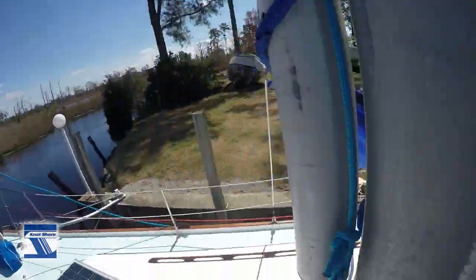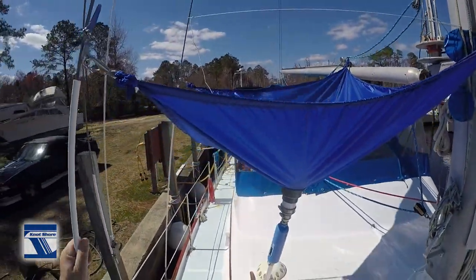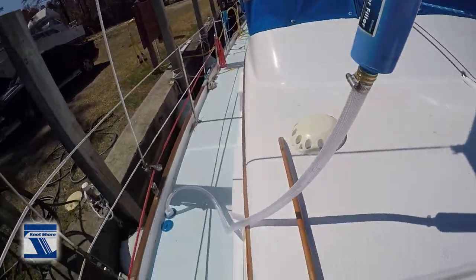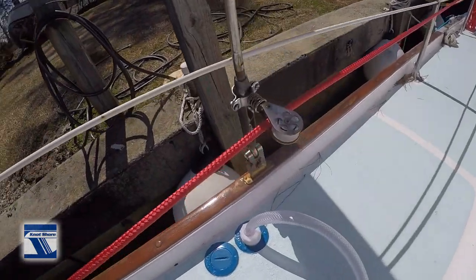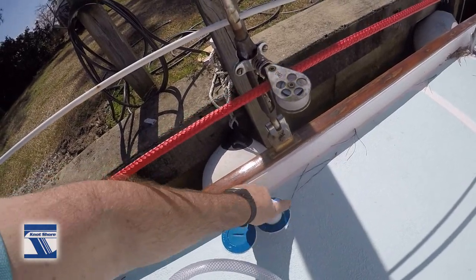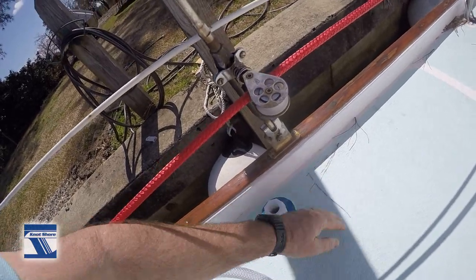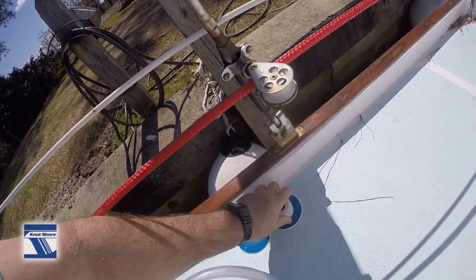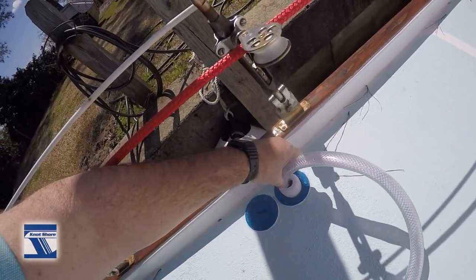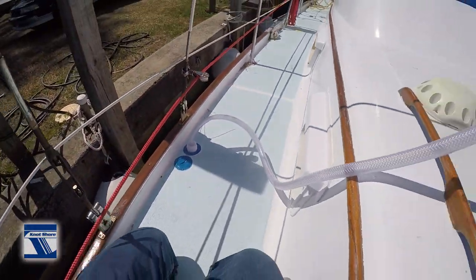And that gives me the rain catcher here, which will feed down into here. I had a couple adapters to get it into the RV filter, down this tube, all the way down here to the water entry to the secondary tank. Got this at West Marine, matched up the threads with the cap, drilled a hole through here. So all I'd have to do is screw that down, put a little tip on there to make it easier for the water to get down, and just push it down in there. And there we go, that's done.